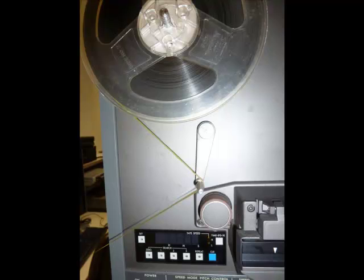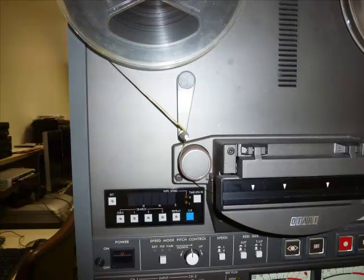Now we will begin to thread the tape over the gears and heads. I will pull the leader down and hook it on the opposite side of this hook. You will see a small groove made for the tape to sit in. From there, bring it around and under the first head and continue leading the tape under the main tape heads in the center of the console.